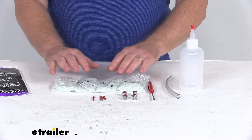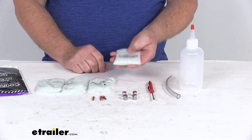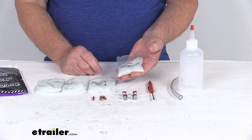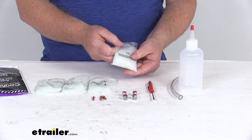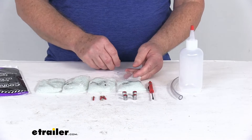These are a very easy installation. All you need to do is throw one of these bags into each tire after the tire is removed from the wheel. Or the other way is you can inject them into the valve stem using the included bottle with the tube right here. The beads will remain inside the tires — they won't come loose to contaminate the environment, and they will not cause any damage to your wheels. One note: if your tire does have internal TPMS sensors, you will need to break down the tire to install these beads.